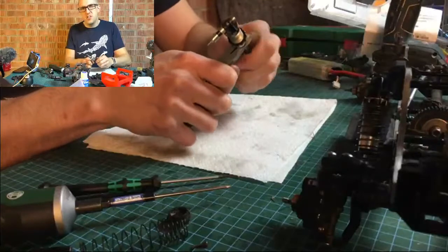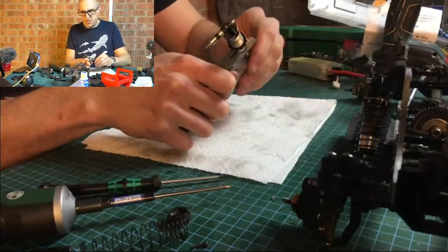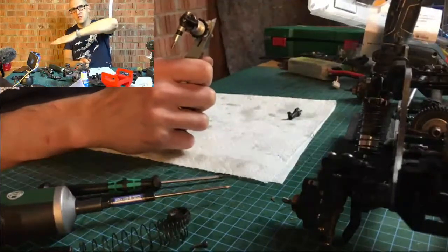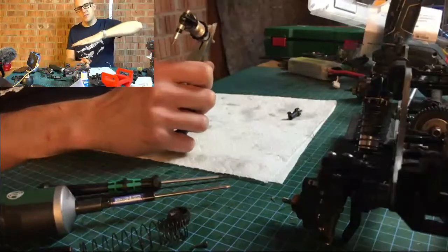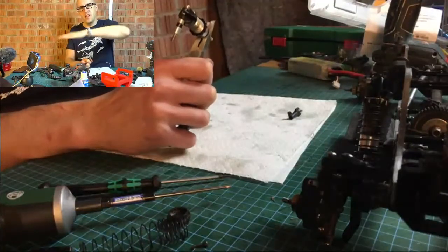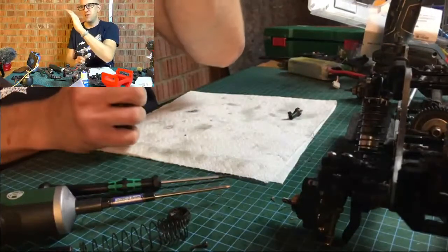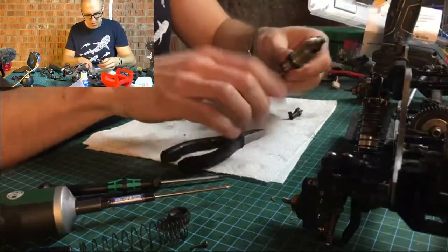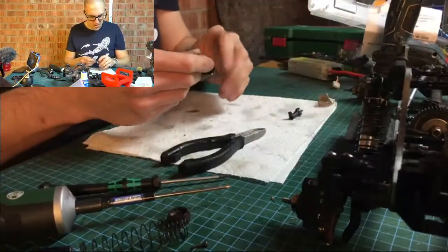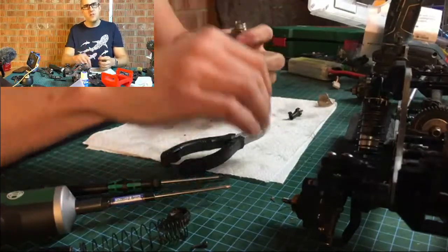Mostly because as the weight shifts to the rear, you start compressing the rear. So if your crawler on a level surface isn't sort of driving along slightly forwards, I know that's not very scale, but if it's not sort of like that, this is slightly exaggerated, then what's going to happen is when you get onto the tippy flat stuff, the rear suspension's not going to be stiff enough, and you're just going to flop backwards. And then you get to the point where your front suspension's not right, and then that flops backwards, and you know, essentially you just flop backwards.